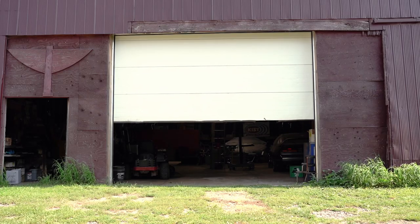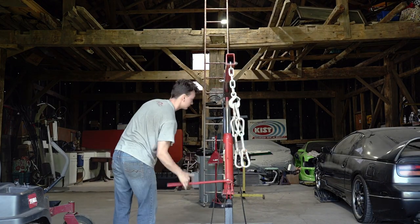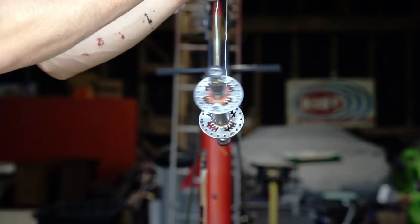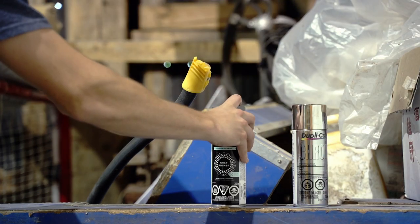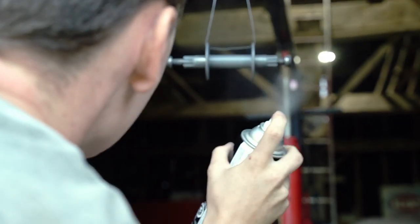After the sandpapering, polishing, and finishing were complete, I took the hub back to my house to put a new color on it. I found the best chrome spray paint I could and decided to go ham, with the help of my brother who has done many spray paint jobs himself. We hung up the hub so it would be easy to spray paint, then got ourselves a primer, the spray paint itself, and the clear coat. We started with the primer layer, which makes the spray paint stick better and stay on the metal.